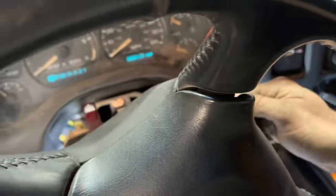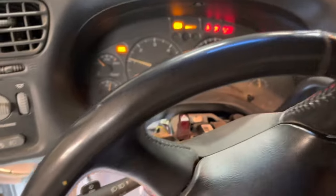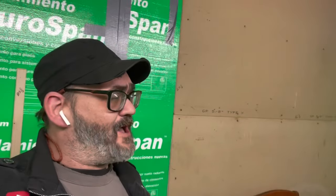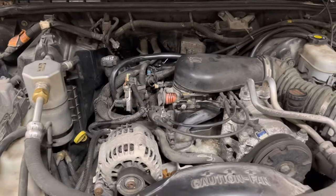I highly doubt I did anything wrong but I want to check and make sure everything starts up. My security light's not flashing — it starts up and runs great. The vehicle's doing something it never did before, which was start. It wouldn't start without me jumping the circuit. But that wasn't the end of my problems — I actually had a bad ignition coil module, which would allow it to run but not give enough spark to go anywhere. I ended up having to fix that one, and that's in my video on different things that can happen with S10s.